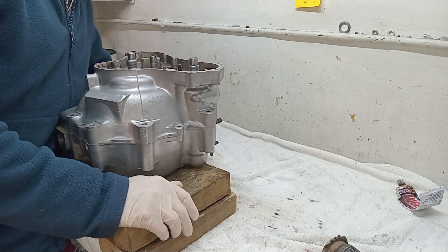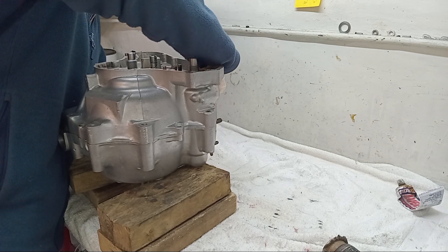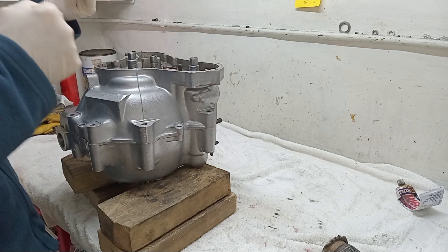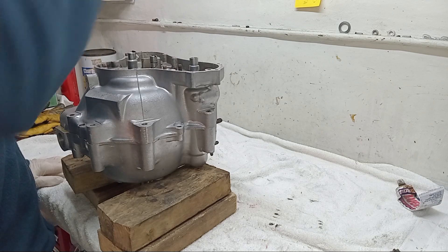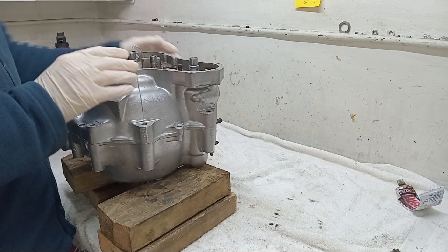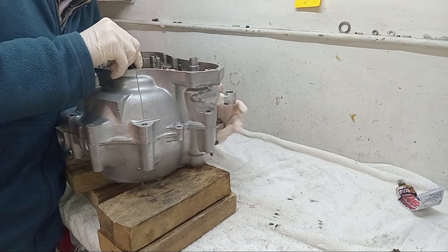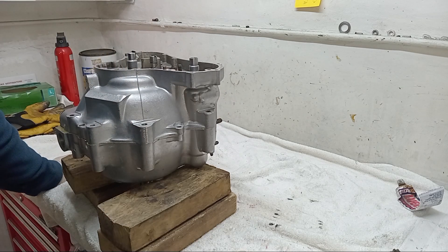The very first thing to do is check the crankshaft turns — and it's all nice and smooth. When we tighten it up I'll check again. If you tighten everything up and the crankshaft suddenly locks up, it's almost certainly that one of the main bearings isn't fully home — normally the inner race on the crankshaft. Even just one thou out it won't run smoothly when you clamp everything up. If it doesn't turn freely after tightening, it's almost certainly a bearing not fully inserted.